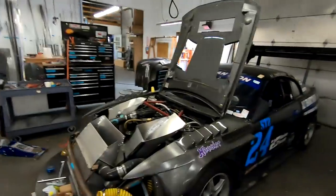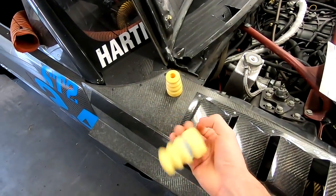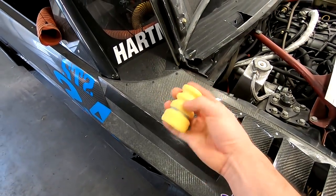The other thing we're going to do is longer and stiffer bump stops. If you watched some of our older episodes when I did the springs, I did put stiffer bump stops in, but I think they're a little bit too short. When the front end compresses and the rear end lifts, that's why the splitter is still able to hit the ground. They're so cheap we're going to try that out before we try anything crazier like a third spring.